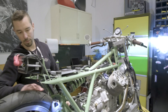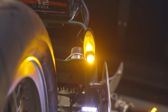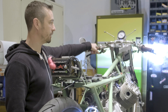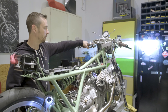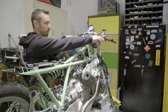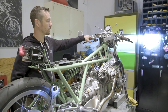I've got my license plate light on back here. Hit the turn signal again — rear turn signal is working. Right turn signal working too. This bike is fitted with a neutral safety switch, so right now I've got the neutral safety switch unhooked. I'm going to squeeze the clutch — it has a clutch bypass switch. Starter's working and my safety switch is working.